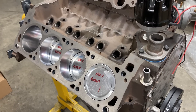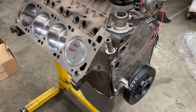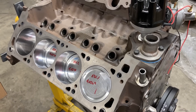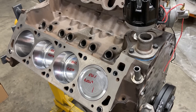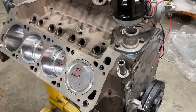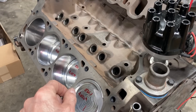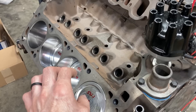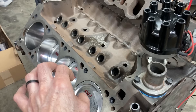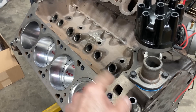The first method is really easy. It's essentially modifying the lifter you're going to use by either welding the pushrod cup to the top, or taking the lifter apart and shimming it up so that it can't go down. The second method is using a solid lifter and checking where your polylock position is on the rocker arm, then not changing that polylock position — swap your lifters out to the lifter you're going to use and measure your pushrod length.